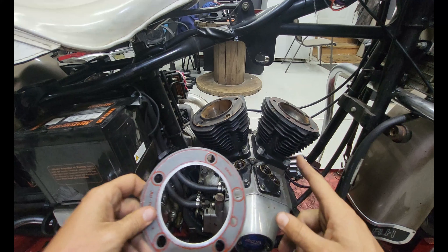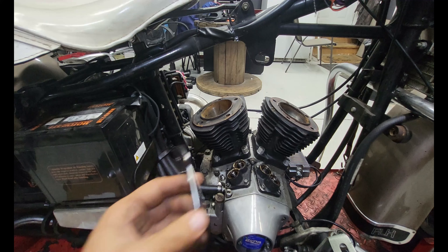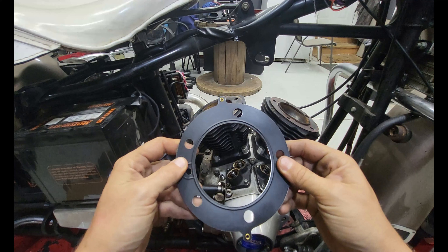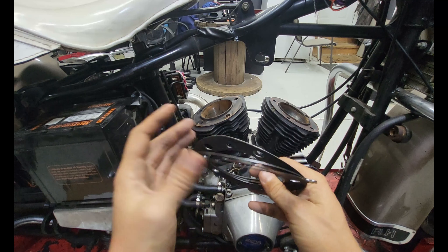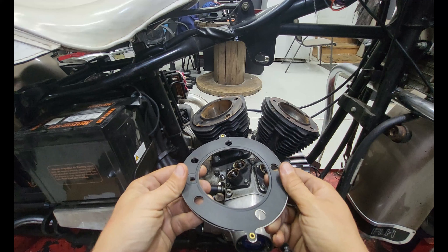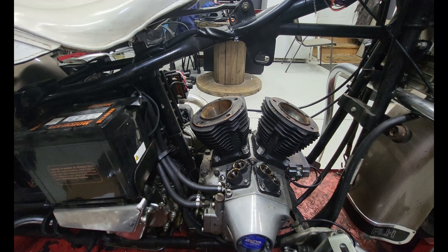It's going to last a lot longer than that blue Garlock stuff. Now, that said, I did order the wrong stuff, so we're going to try something different and I have no idea how well it's going to work out. What I got sent to me - I thought it was a crush ring, but this is a whole ass crush gasket. This is a multi-layered steel gasket, which is what your car or truck has. A lot of times you need to stretch your bolts for these - this doesn't mention that, and Harley head bolts aren't stretched for it. So we'll see what happens.